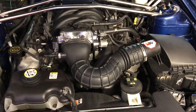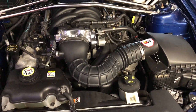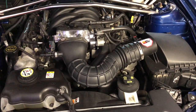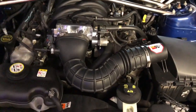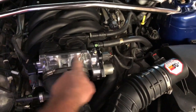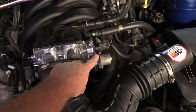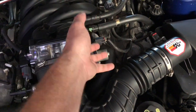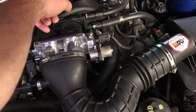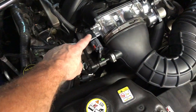Let me move the camera and show you what's going on. I apologize — it's hot in here, I've got a fan running so the sound's gonna be crappy. Right now I'm just going to hold this and show you the throttle body. The stepper motor is here, there's a gear set inside, this is the two-prong plug that rotates it forwards or backwards depending on what the computer tells it to do. On this side is the throttle position sensor.